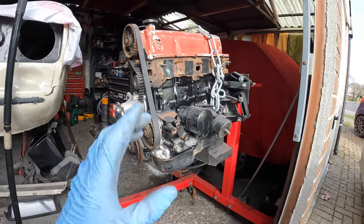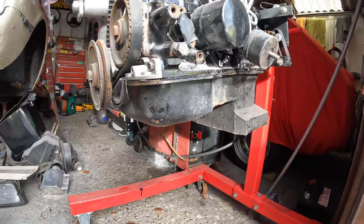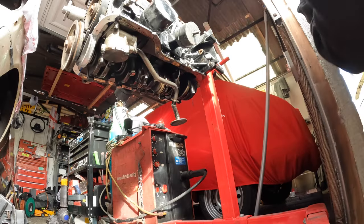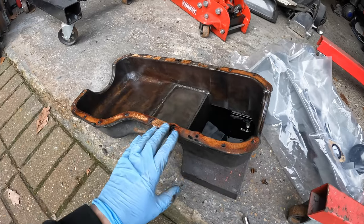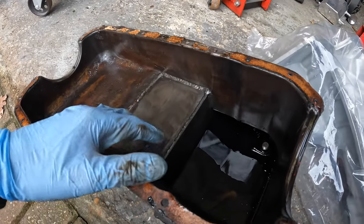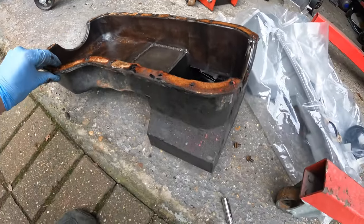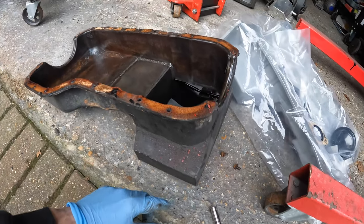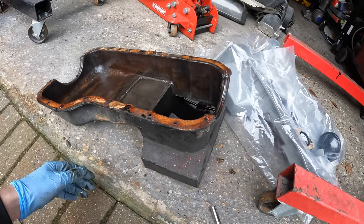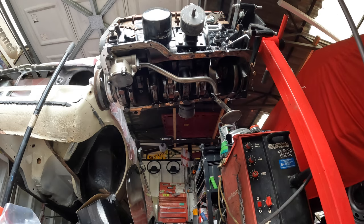After a little bit of effort the Pinto is now back on the engine stand. Here is the old sump — I've got it off; I only had it held in with two bolts. I'm not quite sure what sump this is, whether it's the original for the Pinto, but it's been modified to miss the cross member and fit into a Mark II Escort. It's actually alright — it's just leaking slightly from one of the welds down the bottom. I'll keep it as a backup; I can always weld it back up.